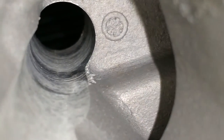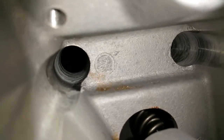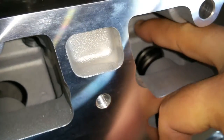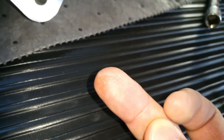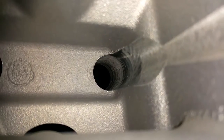Because those shards will fall down into your motor eventually. Over here it's got some grease from the factory, and the grease captured some shards of aluminum — you can see it right there. So check your heads out and give them a look over before you bolt them on.